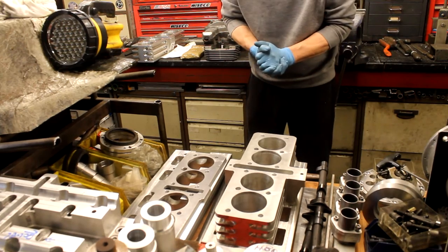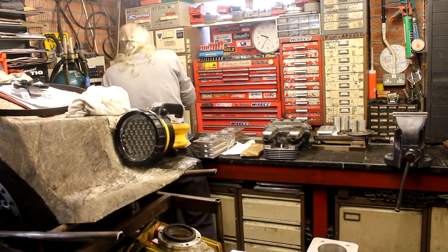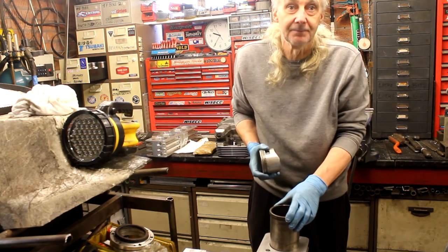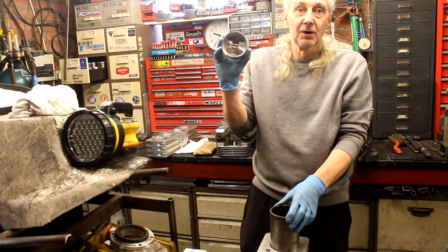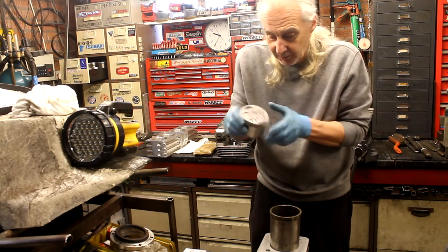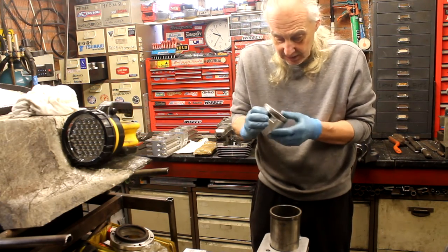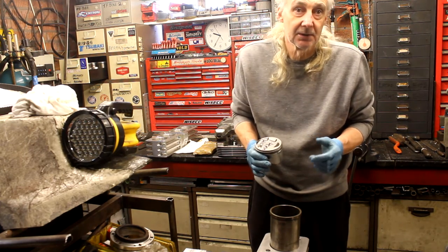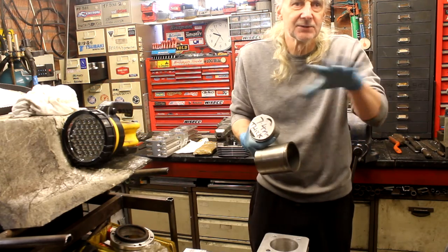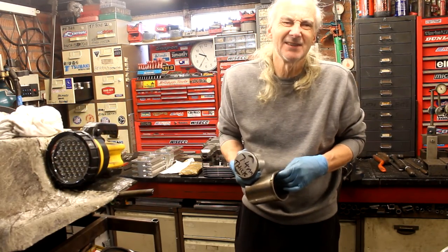Have you got the pistons? I was tempted - I don't know whether to do it. You've been making pistons but they're completely out - do you know that 1500 block? I don't know whether to finish boring that off and use the 1500 kit. Well the rods are right at 18 mil. The only snag is we've got one of these pistons that's just got a few little scuffs on it but I'm sure they'll polish out. So basically it'll end up at 1500cc - whatever give or take. Those pistons are the ones I bought with that cast billet block.